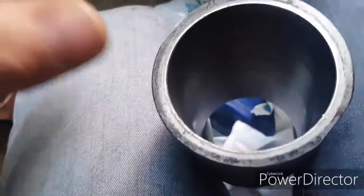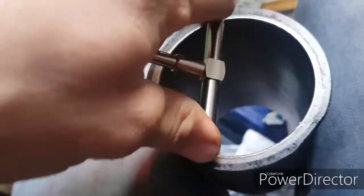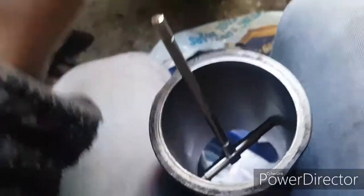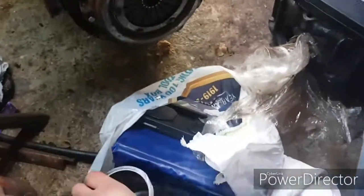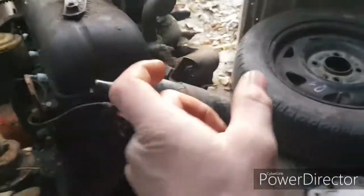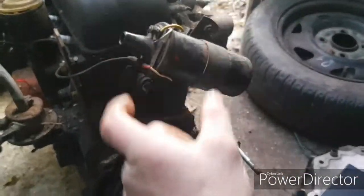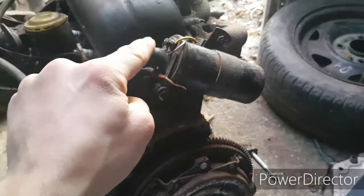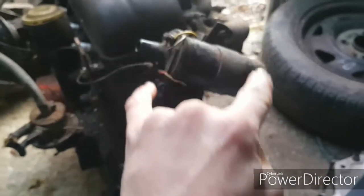So in that respect, where I found the piston rings were still nice and square, I believe the actual problem is the fact that these liners appear to have just gone oval. What's effectively happening is, if you imagine a tube like that, supposed to be dead straight on both sides with two parallel lines, but then the middle of it eggs outwards like that, making it an oval shape.